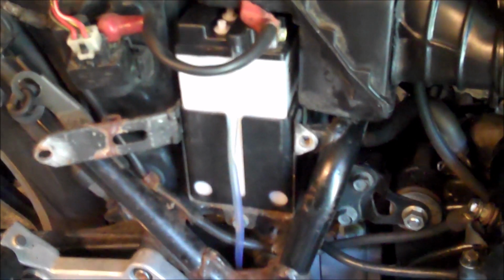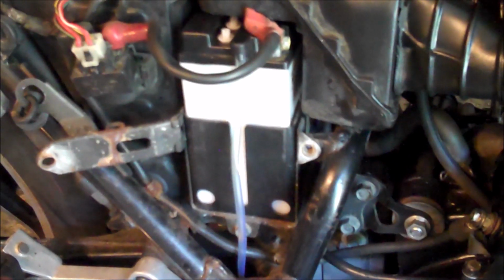Battery acid leaking out of your battery is actually pretty common. That's why they sell them with these long overflow hoses, which sort of just hang down. It happens when you have a dysfunction in your charging system and you're putting too much power into the battery, maybe you've got a bad regulator rectifier or whatever. The thing will start to burn, not literally, but you'll burn out your battery, and it'll overflow the fluid inside, and you'll have little dribbles that come out. Not that big of a deal. You might have to replace the battery and then fix whatever's going on in your charging system.